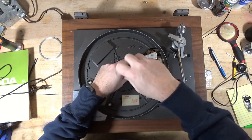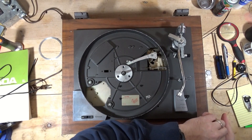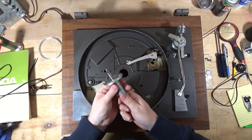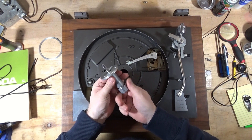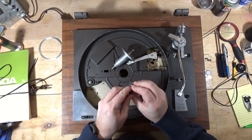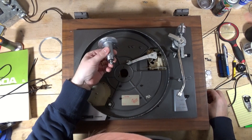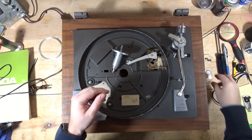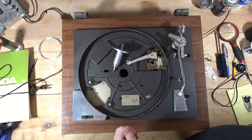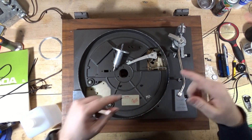Let's see how our speed improves. I haven't done anything to the motor on this - I may have to. I've been doing more research on the PL-50s and it seems that coming up to speed is kind of a common issue with these older turntables. This one takes about a minute to come up to full speed. Here I'm going to clean out the remnants of that old thrust bearing, clean this up a little bit, then pop the new one in. It comes from Pat's Audio with a little gasket to go around the shaft.